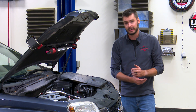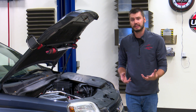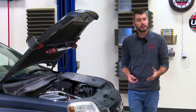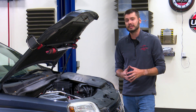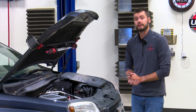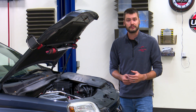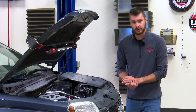If you're chasing an intermittent problem or a check engine light that's coming on even after you've replaced the solenoids, you could be dealing with a circuit issue or a PCM issue. To diagnose those, it's going to take a little bit more than an ohmmeter. If you're looking for a video on how to replace the solenoid, it's pretty straightforward — there is a link down in the description for that as well, and we'll take you step by step through replacement of the VVT solenoid.